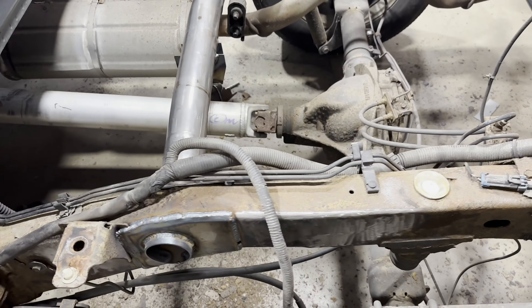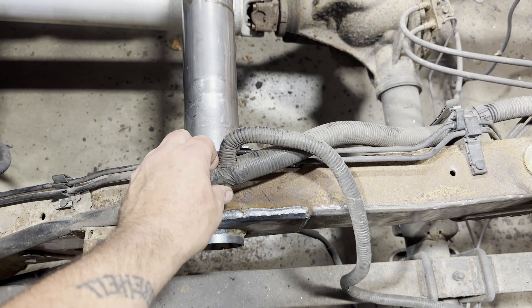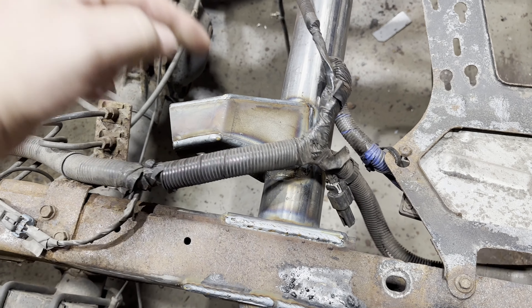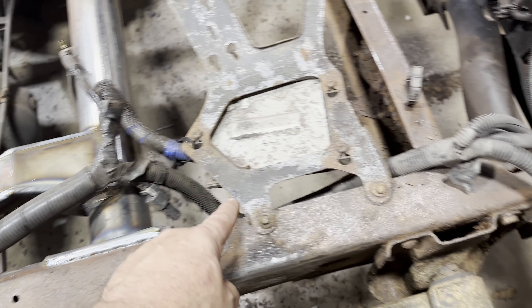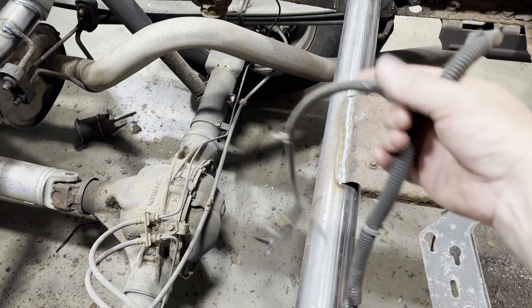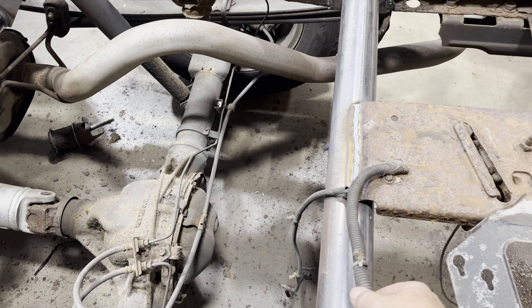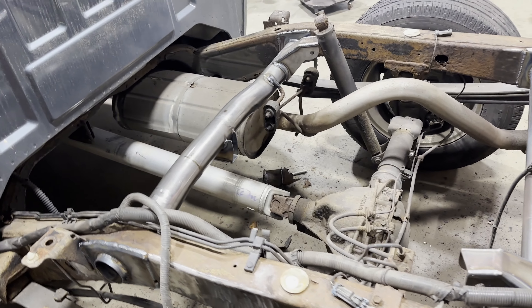One thing I need to make you guys aware of — something I've made the mistake of a couple of times. Before you start burning these tubes in, make sure that your harnesses are where they need to go, especially this rear one, because I've accidentally let this harness fall down below and then put the crossmember in and had to basically unrun the harness from all the way back and get it back over the top. If it ends up below it, it hits a shock and does all kinds of crap, and then the ABS sensor doesn't reach to the other side because the harness is too short, and your ground wire doesn't reach where it's supposed to. So just make sure all your harnesses are exactly where you need them to be before you go welding these things in, because it makes life a whole lot easier.